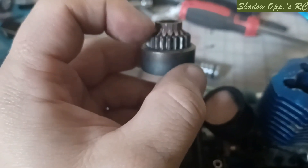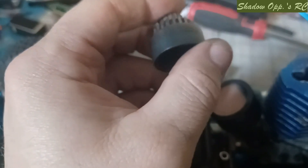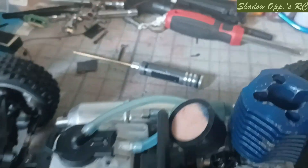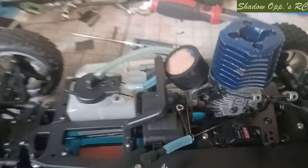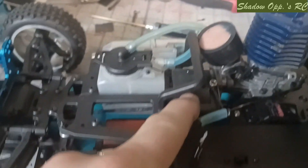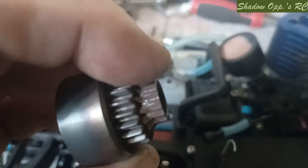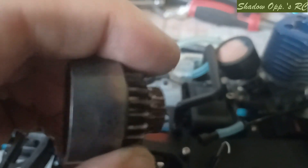I'm not really running mine right now. I have an upgraded metal gearbox where this is all metal, metal gears. And between the power of this engine, not having the mesh completely right, and I think my secondary clutch isn't working right — it blew the teeth.